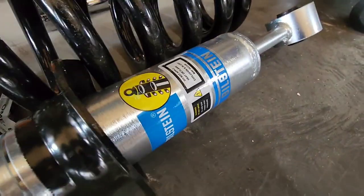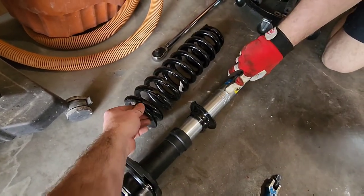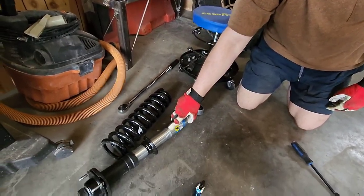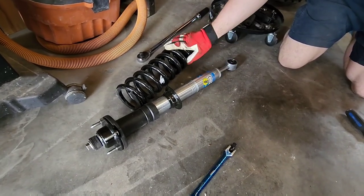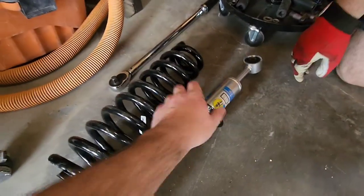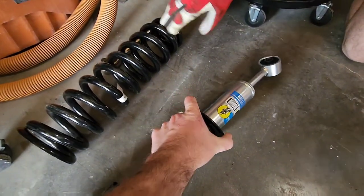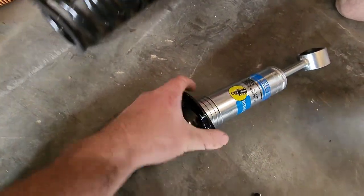You can reuse your old spring and change this little disc here, and that's what can give you your different level heights with your stock spring. Or you can put it in the zero position and then buy a spring that gives you the lift. This is OME — Old Man Emu — 2887. So this is where the two-inch lift will be coming from, but you can use this same adjustable strut either way.